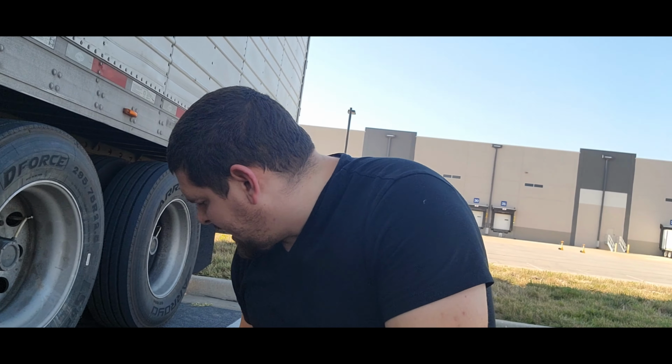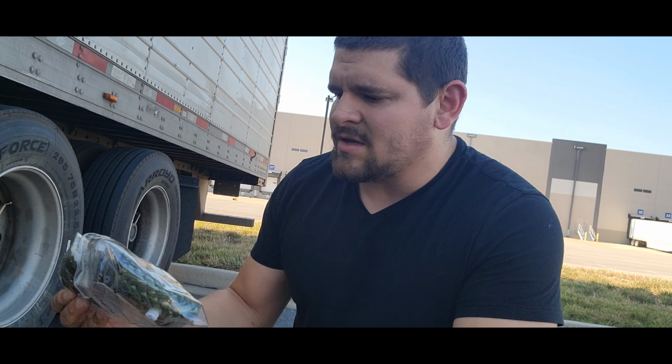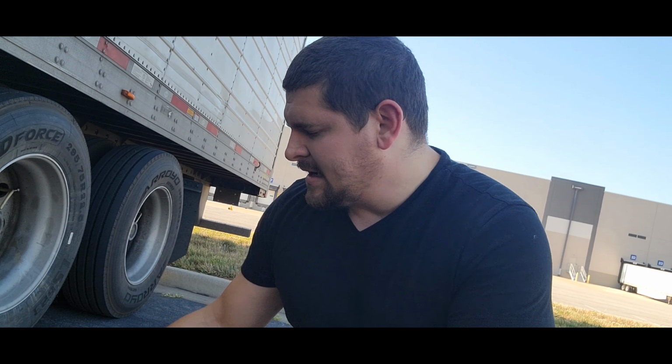These are not tow straps. You probably could tow with them in a pinch, but tow straps don't have the elasticity that these ones do. These ones, when you give them a good pull, they allow a little bit of movement so that it doesn't just rip off whatever you're pulling against. And the soft shackle is supposed to be able to wrap around more sensitive stuff, so that way you don't have that kind of sharp force against whatever you're pulling on.